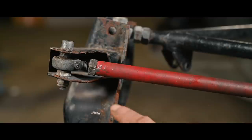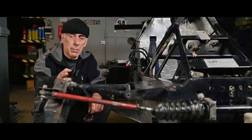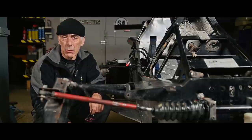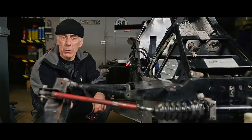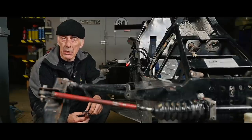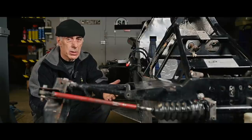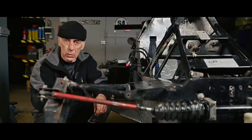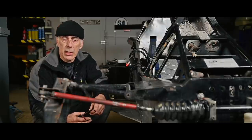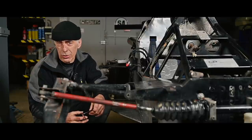The upright has seen better days, so we'll take it apart, blast it, and repaint it. I'll do the same with all the wishbones. So folks, all that's left is to disassemble all these parts, clean them up, shell-blast them, and paint them. Then I'll rebuild the brake calipers, install the new master brake cylinders, and we'll see it all when we reassemble the front. Then we'll work on the rear of the car — there's also a suspension back there, and I have a bent drive shaft. I hope you enjoyed it — I know this was a lot of theory, but that's what suspension systems are. Thank you for watching and hopefully I'll see you in one of my next videos.